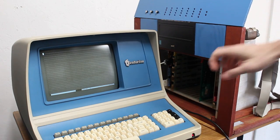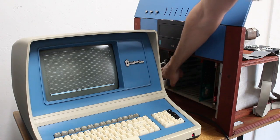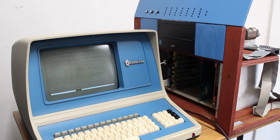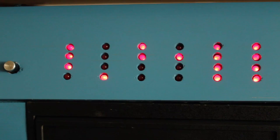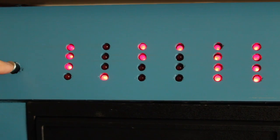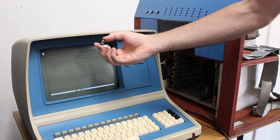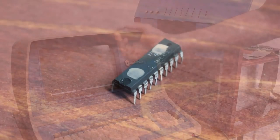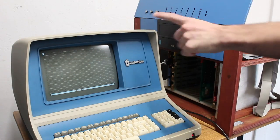It was a little more involved than I was expecting. I tried three different memory boards — none made any difference. I tried different MUX cards — no difference. I pulled the CPU 6 card, tested it in the genuine machine, and it works fine — I get a 'D=' prompt. So that meant we were down to either the front panel or the back plane. The front panel LEDs were lighting up and showing an address, and the reset button worked, so I suspected the back plane. There's really only one major thing to look at there — the bootstrap ROM.